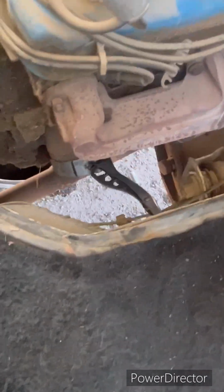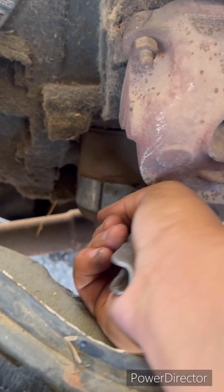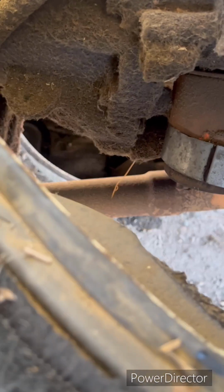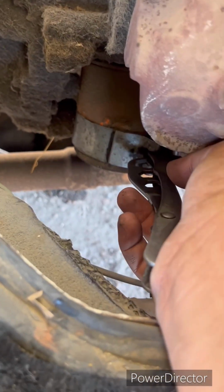Okay. Now, I think this one's blue. See that little circular thing? That thing right there. That's your oil filter. You want to take that off with your wrench. Then, once we get to the next part, I'll show you what to do next. Okay, in this case it's nice because the motor is right in the cab, so usually you're going to have to get on the ground, but in this case I don't. So just loosen this and then get it off.